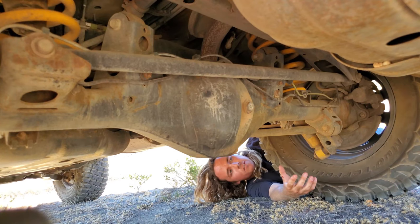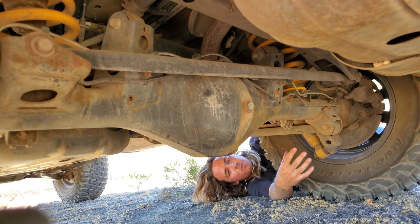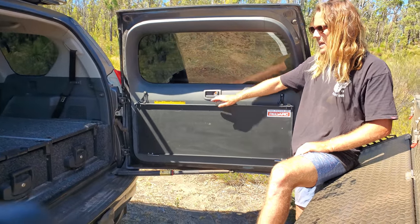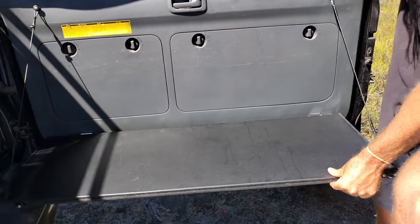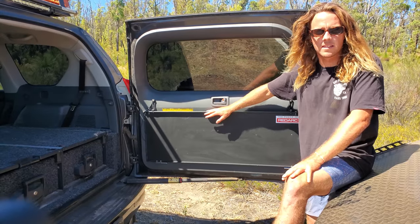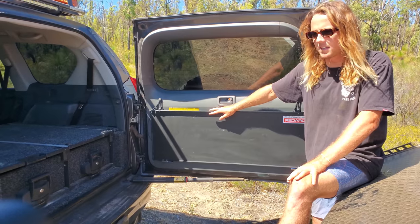In the rear I've just got 400kg constant load King Springs coupled with Bilstein 2 inch shock absorbers, and with the caravan it sits nice and level. On the rear door here I've just made a custom drop-down table out of some folded aluminium powder coated textured black with some switchboard hinges. This makes camping and touring real easy — we can just pull up on the side of the road and prepare lunch on it.